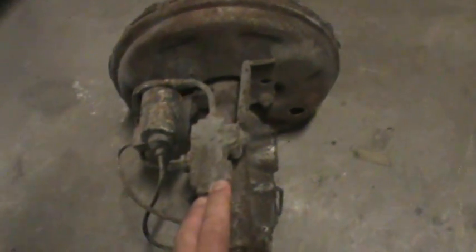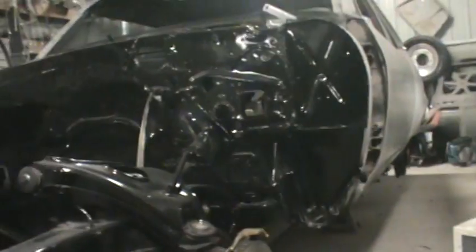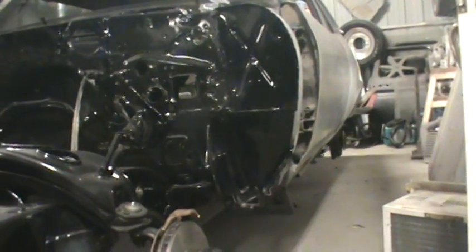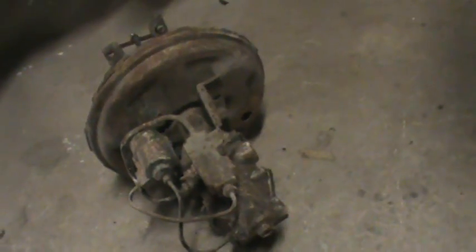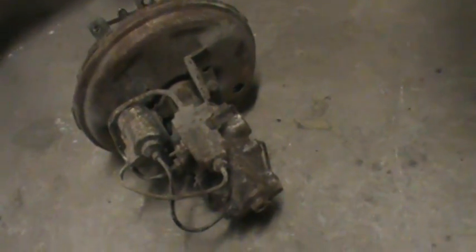But you know, you got the master cylinder, and then you got this thing under here, and then you got this baby here, and then you had a proportion valve, I think, that hung down a little lower. And when you plumb a Volkswagen, you got the two brake light switches, the front port, the rear port. You split the one in the front, you run a line to the back, and you split it to the two wheel cylinders, and you're done. But not so on these. So sort of learning about the brakes, how to plumb them, and all that stuff. Been watching some videos, but I'm gonna have to do something. I'm sure all this stuff has to be incorporated, but it's probably not going to be the same components.